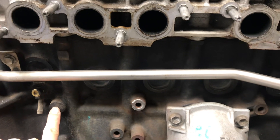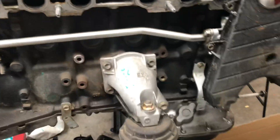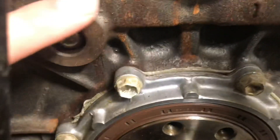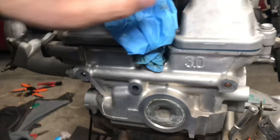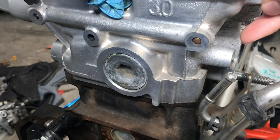This is a GE block, so these are not drilled out because the cross from the other side is not drilled out. This spot gets drilled out to connect this oil tube to this oil tube — these galleys right here. I need an oil feed on this side for a turbo, so I'm going to try to take it from here or here.